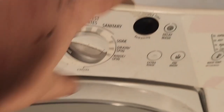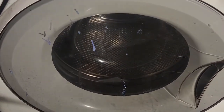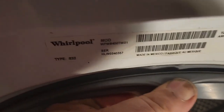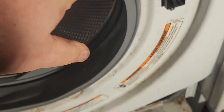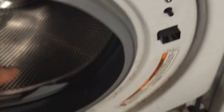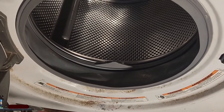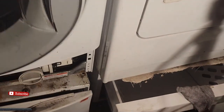And then this plastic control panel came off. I gotta take that and move it to the side. And then you can get out the four screws. One, two, three, four, to bring the front off. The rubber rings have this. You see it? A wire clamp. This one is springed. The inside one, same kind of thing, except there's a screw on it to tighten it. That's how you take it off. That's the tricks.